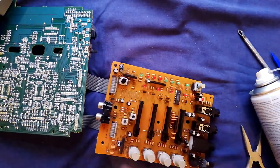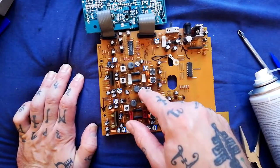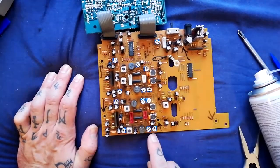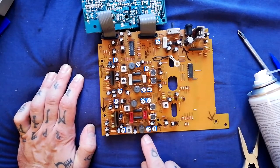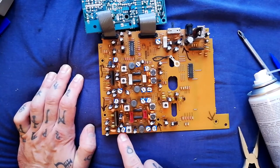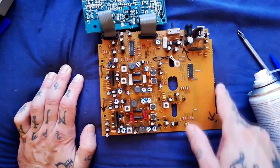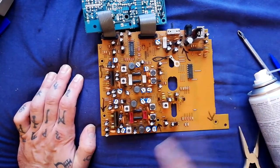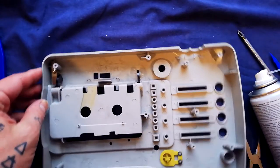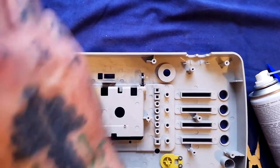You'd also want to clean your main volume for the line out and the headphone socket. Should you need to calibrate it, these blue and white components are the trim pots — they are sensibly labeled: bias, frequency, record (that's record level), and rep (that's reproduction/playback level). I have plenty of videos about calibration on my channel — check out the channel splash page.